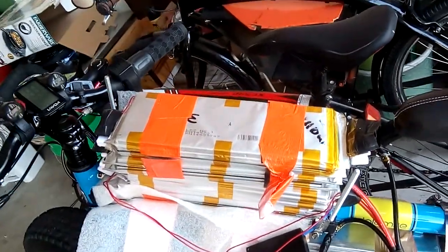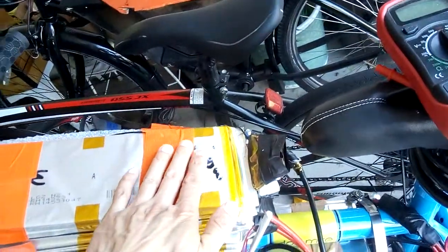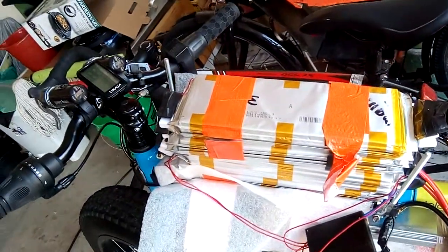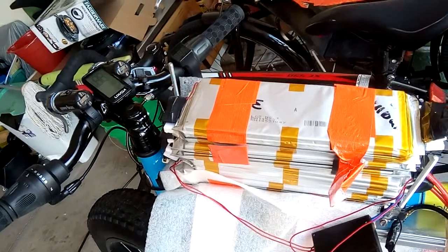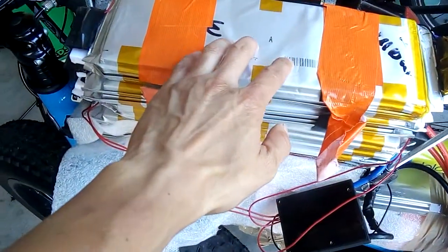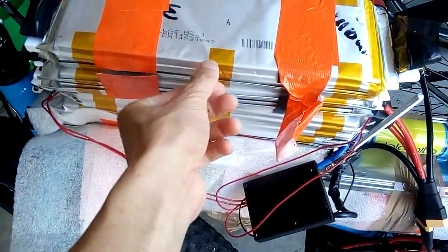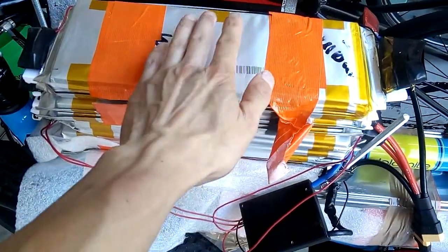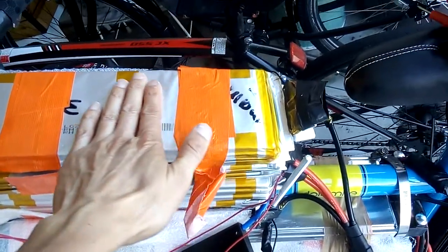But I think it's still okay to ride now, as it is. Even though it leaked a little bit of electrolyte, I think the pack is still okay. It's not optimal, so I still will ride it a little bit here and there. Nothing too crazy, like full gas, full juice, or anything like that. Even at full juice, it shouldn't be a problem. One of the other problems besides the leaking electrolyte is that it broke the seal, and this seal kind of just scrunches up the alternating cathode and anode plates together. And when it's not pressed together, it increases the internal resistance of the cell.